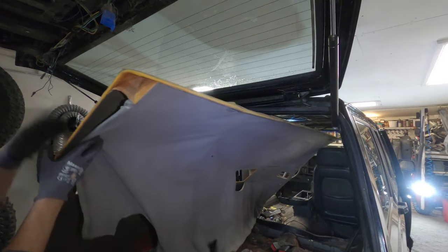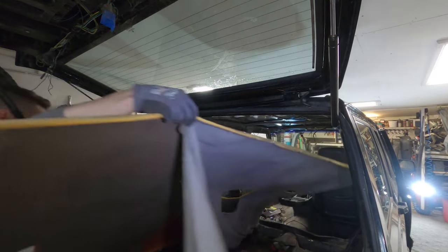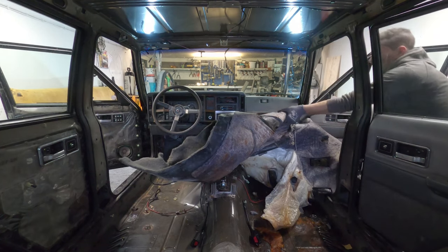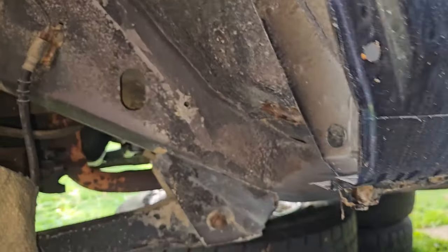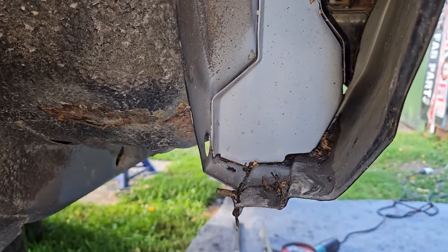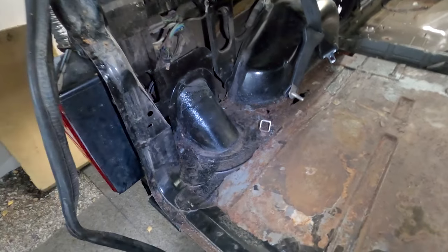Having an idea is just the beginning. The first thing you really want to be doing with the Cherokee is inspecting it thoroughly, and one of the first jobs I would do is pull that carpet out. You've got to have a look at what's going on under there. The Cherokee carpet is terrible - I ripped the carpet out of my four litre and underneath it looked fantastic, but there was some serious corrosion in the back, not from underneath the vehicle but where water was trapped underneath the carpet.